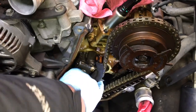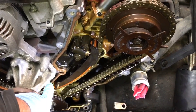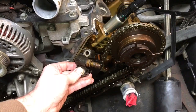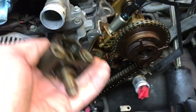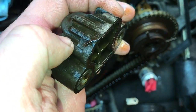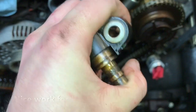The gasket is leaking oil pressure, so it's not able to apply sufficient pressure to that timing chain. Because of the looseness of the chain, it has actually jumped, leaving this camshaft in that retarded position. Here's the timing chain tensioner from bank two — you can see the gasket right there is blown out. All that fuss because this tensioner was bleeding out and was not holding tension.